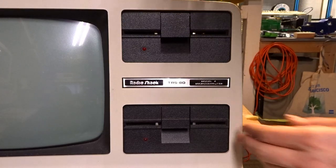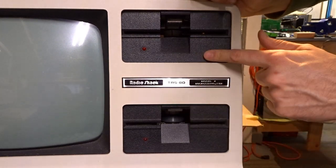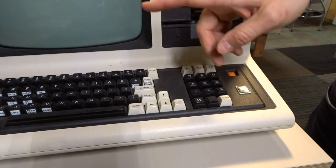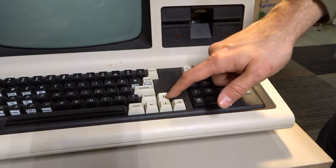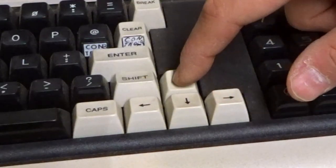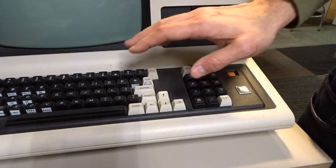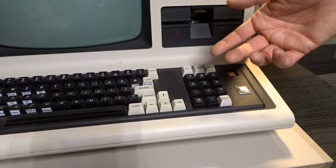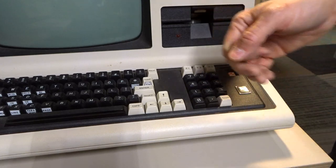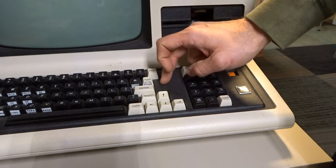The CRT looks pretty good — just slightly dirty but otherwise in decent shape. Here are the two floppy drives; they seem to be working fine and are pretty clean inside. One thing to note is that the Gate Array models, which are the more desirable ones, have the green phosphor — we can't tell yet because we haven't turned it on — but they also supposedly have the arrow keys in this clustered configuration. The earlier ones had arrow keys split across two sides of the keyboard. So I think this might be a Gate Array.